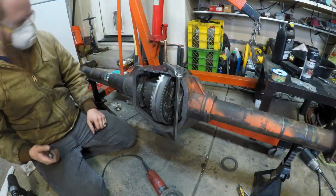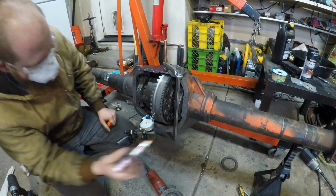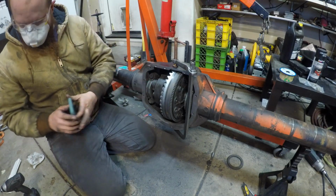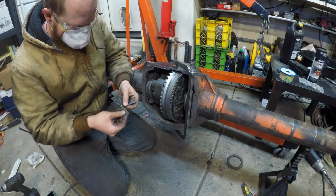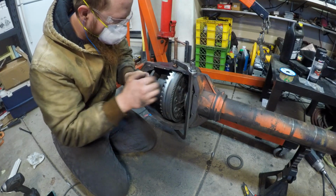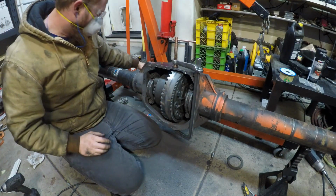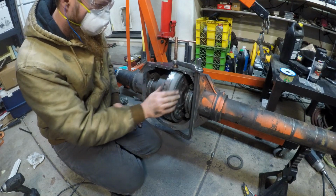Well, let's find where my new minimum is, because that old minimum isn't my minimum no mo. This is new minimum, so I'm going to just throw it over here and make it small. So my final measurement needs to be 71.5, and right now I believe I'm at 40. Let's take the 20 and the 19. That's 39. Yep, that fits. Well, that feels pretty flat across. I still kind of feel like there's a bit of a taper. But it really only matters that the teeth are the right diameter. This, not so much.